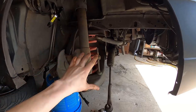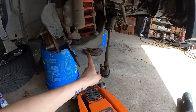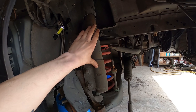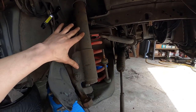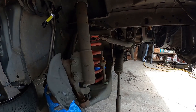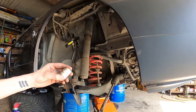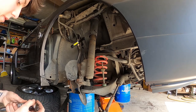We're going to remove the strut, but it's very important that we put a little bit of pressure on this control arm when we jack this up. The strut is the only thing really holding the suspension up right now, and the spring in the back is holding the suspension down. So if you just drop the strut or remove it, the spring could come flying straight out — which would be a very bad thing because you would get hurt. Preferably you'd want a block of wood on this. I'm going to use the breaker bar just to start it out.